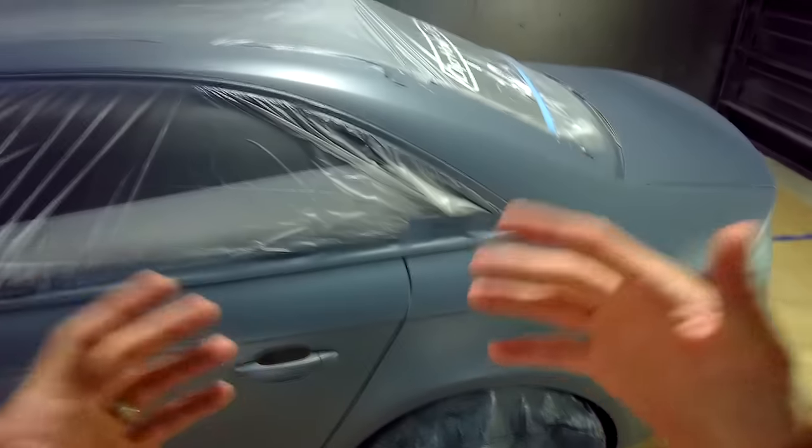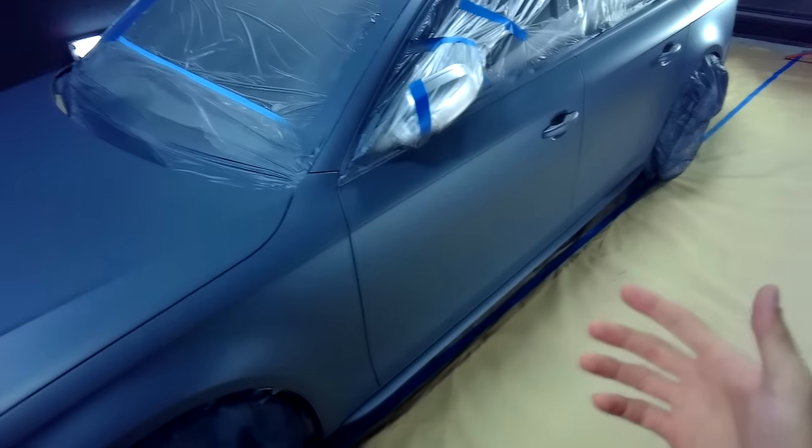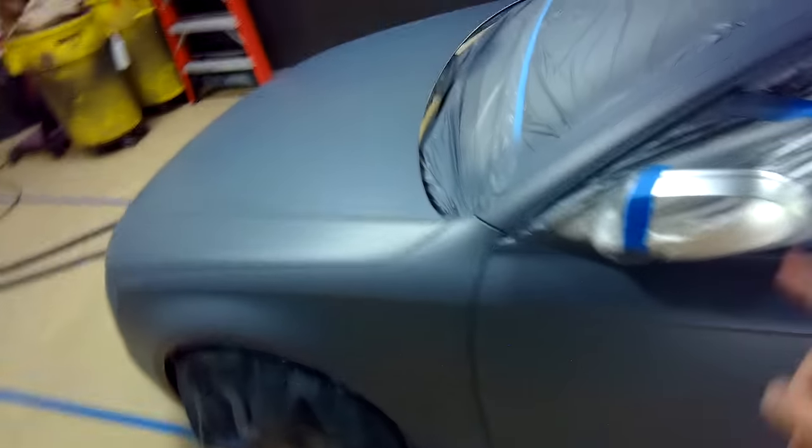This is after the second coat is completely dry. It's really important to make sure every single coat gets a full 20 to 30 minutes to fully flash out. You don't want to stack wet coats on top of wet coats and trap those solvents in there. Make sure all the surface areas, all the little cracks and corners, are completely dry before moving on to the next coat. You're going to get very quick coverage with a base coat like Gunmetal Gray or black, but you have to use up 100% of your base gallons. There will be spots on the car not fully covered yet, so keep going. The most important thing when dipping your car is you want it to be durable and peelable, so use up 100% of all the gallon product in your pro car kit.